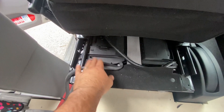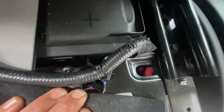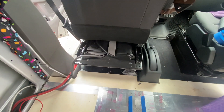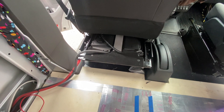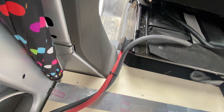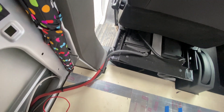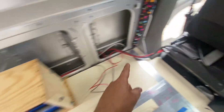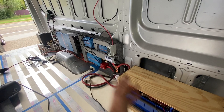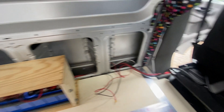Underneath this cover here is a nice chassis ground where the rest of it comes in. If you can see in there — those big thick red cables go directly to the alternator, or through some kind of controlling mechanism, and there are posts right here to connect. We're doing two-aught cable because that's capable of around 160 amps. I tested it — we were able to run that heater during a load test and still charge the batteries at around 60 amps, which is pretty impressive.